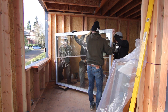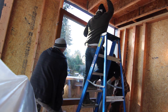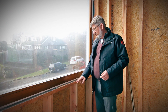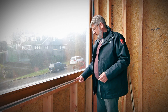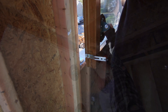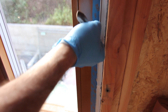So we've got our window from the factory — this is a good example, a very simple picture-frame window, non-operable casement. Into the opening we've got a liquid-applied membrane, the black stuff, that goes from the interior side of this window — we bring it in just enough, not wasting material too far inside the framing. The window goes in, structural clips are mounted to the frame of the building, backer rod and air dam go in. So now we've got an airtight assembly from the window through the highly elastic sealant down to the liquid-applied membrane, which transitions to the outside face of the building.